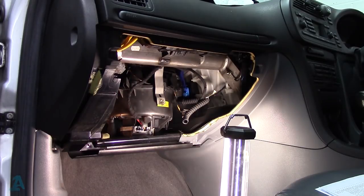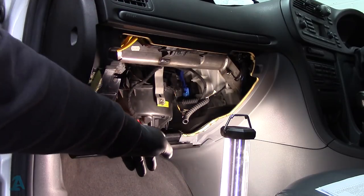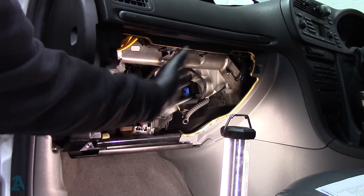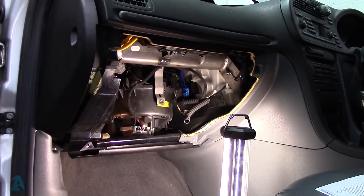So of course, I just want to confirm my diagnosis. Go take your glove box out. Underneath the glove box, you've got two screws which are T25s, and then you've got two at the bottom. Open the glove box, you've got one either side, then one in the middle. That comes out. Disconnect the glove box light and the pipe for the AC into the glove box.